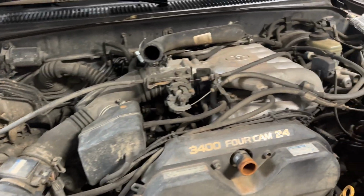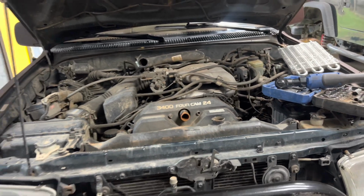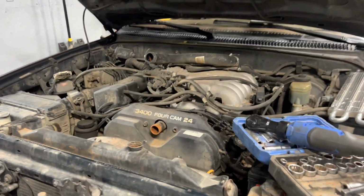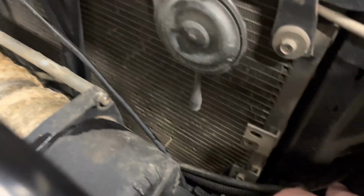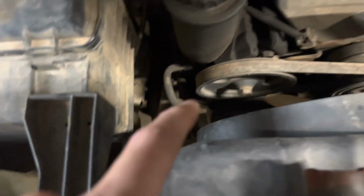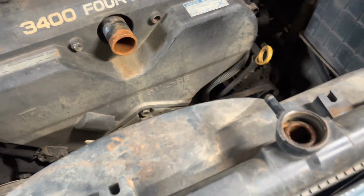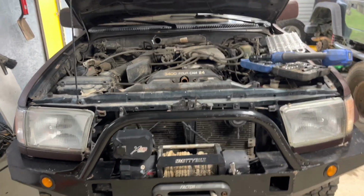top radiator hose off, pulling this off. I'm gonna look in here and check some other things over while we're there, but we're gonna set up some videos and show you how to pull this radiator out and what to pull out. Looks like there's a bolt down there. There's gonna be a bolt up under here. Same on the other side, but pull these 4 out, pull the shroud off, and then pull those out, and should slide right out of there with the bottom hose unhooked in the transmission lines. We'll put some clips up and show how to remove this and go from there.